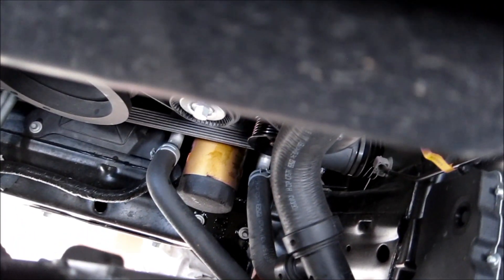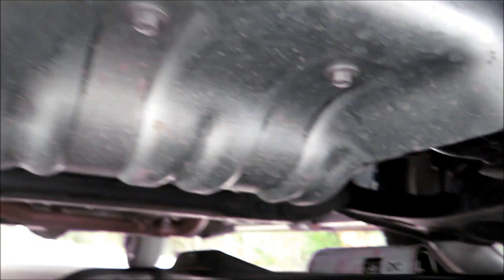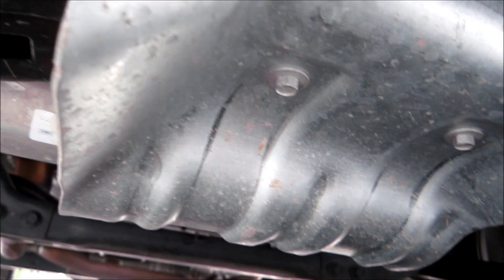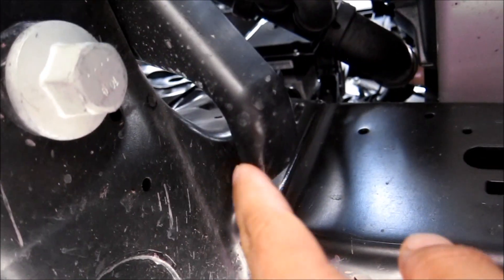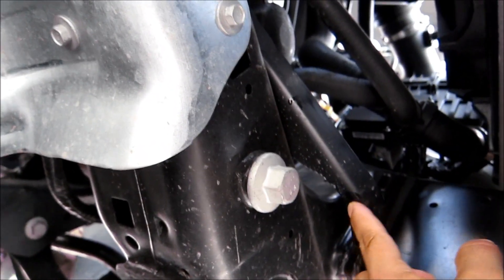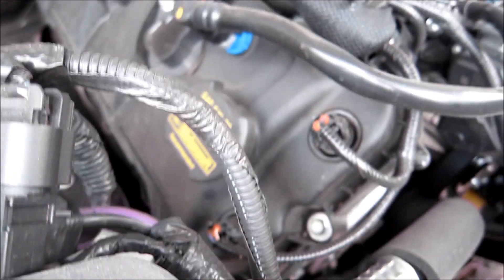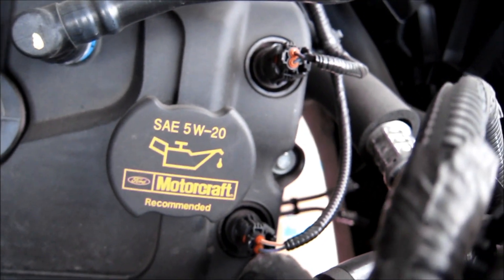Work from the bottom of the truck — that's how you get your oil filter out. This is tricky: you see this big metal oil pan? Parts of your oil filter will drip to the back of that, so be ready. It looks like Ford tried to help by creating this piece that looks like a long drip pan. There's a plastic piece and your oil filter is right at the top of it, so you can do all this from below. Luckily I didn't need an oil filter wrench to take it off.